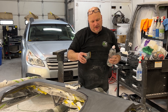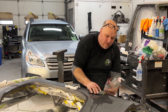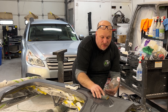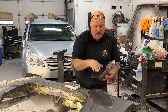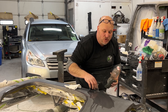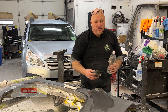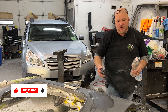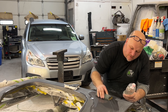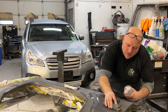Another thing I forgot to mention: when you're sanding, you're listening. If you hear a little scratch or anything aggressive, stop immediately, rinse everything off, sometimes change your sandpaper, then go back and hit that area again. What happens is if there's a dirt nib in the paint when you sand it, it could come out, or a bubbled-up piece of clear coat could come out, and then you'll put some really heavy scratches. I like to wash in between every single sanding — you don't need to, but if you clean it, dry it off, and hit the next sandpaper, you can look and see if there are any really big scratches.